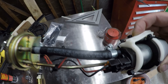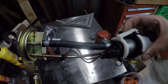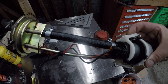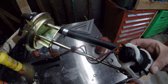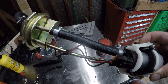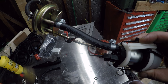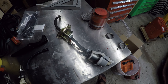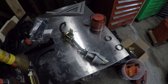Here you can hopefully see the Dayco submersible fuel line. To be fair, this is the J30R10 spec. And also on here, these ABA mini hose clamps — they're stainless, made in Sweden. They're the only way to go; the only decent clamp I've found in the last few years. They cost a little bit, but honestly there are a few places where you can get a pack of them for relatively cheap.